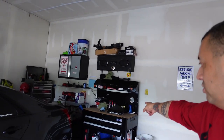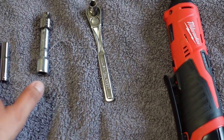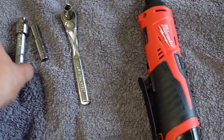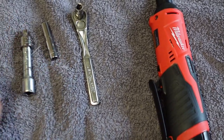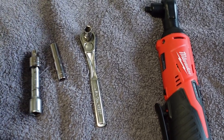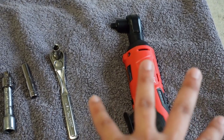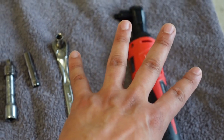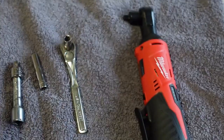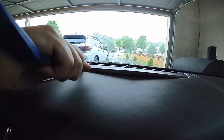Let's get the gauges installed. The tools you'll need are a quarter-inch ratchet with 7mm sockets, an extension for hard-to-reach areas, a plastic pry tool from Harbor Freight, and optionally a small power tool for easy-access screws. Do not use the power tool on hard-to-reach areas, and don't overtighten with it either as you may break things. That's pretty much all the tools you need.